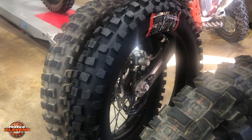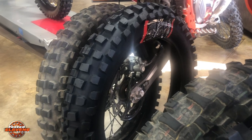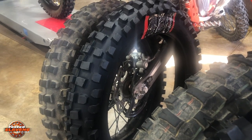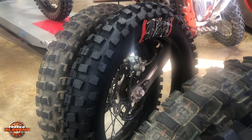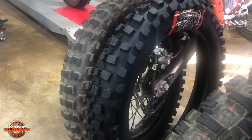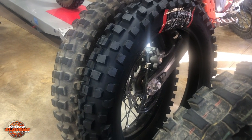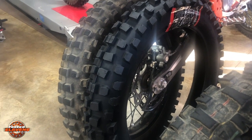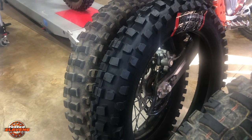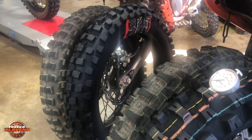If you overinflate your tires — a lot of guys come to Colorado to trail ride in the summertime from other states and they're so paranoid about getting flats that they run 15-16 or more pounds of air, then they bounce down the trail with no traction. This nitro soft mousse really helps with performance, whereas regular mousses have their own advantages, but the disadvantage is when they're new the traction is poor because they are so firm. Just something to think about when setting up your bike.